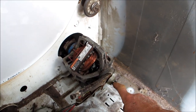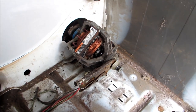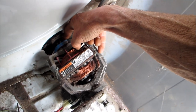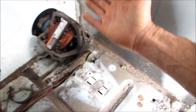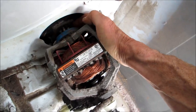What I'm going to do is turn it on its back, pull this bearing cap off, let it weep in, and then I'll turn it on its front. Let's take this door off. Turn it on its front and pull this back bearing cap off here, and let it weep in from the back. So we pull the front bearing cap off, lay it down, let it weep in, work it around, and then turn it on its face and let the oil weep in from this end.